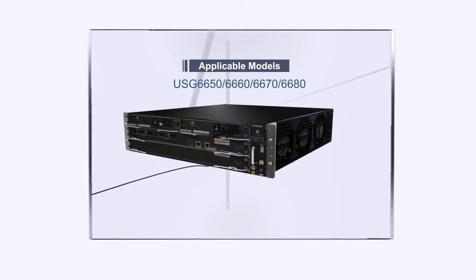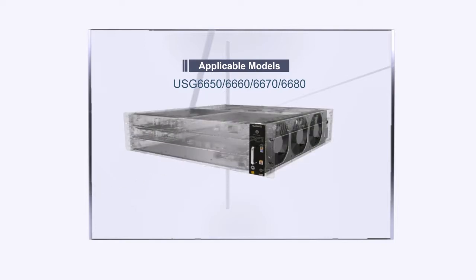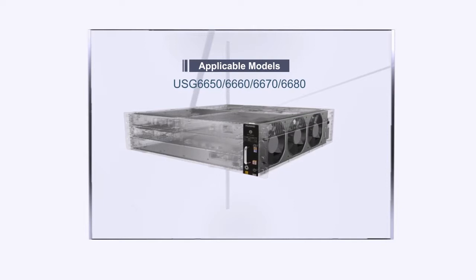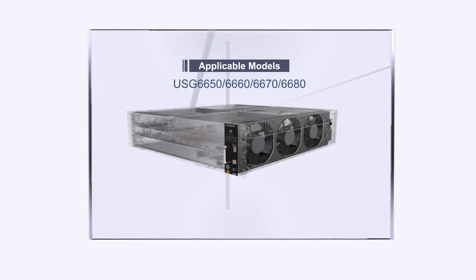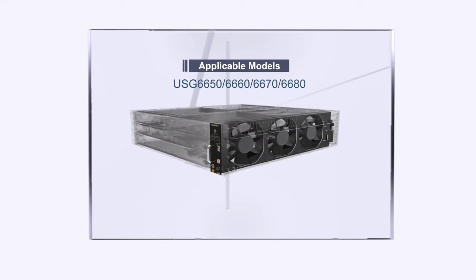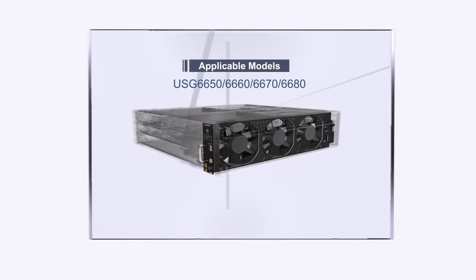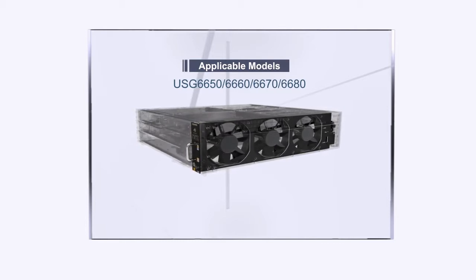In this course, we will learn how to replace a fan module. The USG6650, USG6660, USG6670, and USG6680 provide an independent fan module for ventilation. The fan module contains multiple fans. If one fan fails, replace the entire fan module immediately, otherwise, system ventilation is affected.